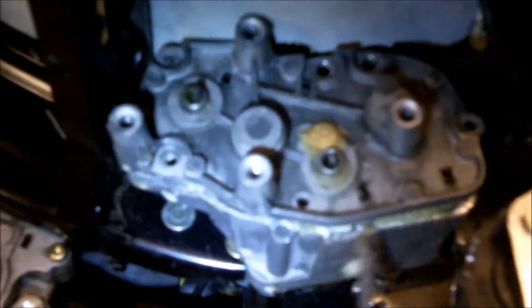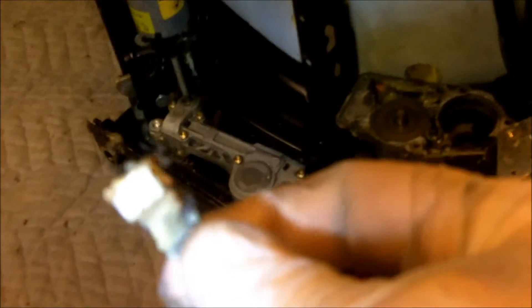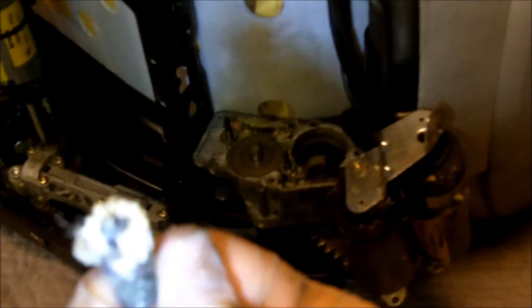I'm going to put a little mark here so that I know the orientation. To take the lid off, start with a screwdriver and gradually pry it up until you get the top loose, then remove it. The culprit is right here — without moving the seat, the goal is to remove this helical gear and the broken piece. You can see the gear is broken, and that's why the seat was stuck. Make sure you get the old piece of broken gear out and inspect the whole thing for shrapnel.